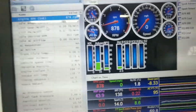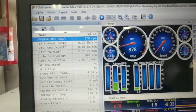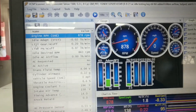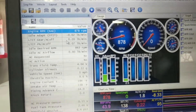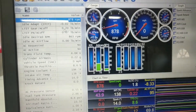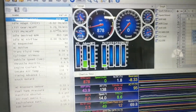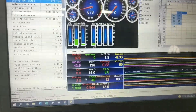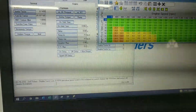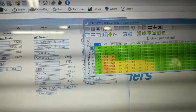There are a few things you need to do even if your car idles okay. If your STIT — short-term idle trim — or your LTIT — long-term idle trim — is too far off, even if the car is idling fine, if that value is above about 0.5 pounds per minute — mine was about 0.7 — it was not allowing the AC to turn on. It was also idling really poorly and dying.